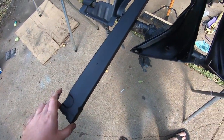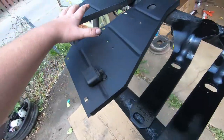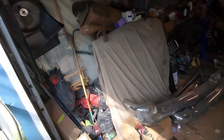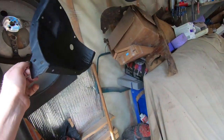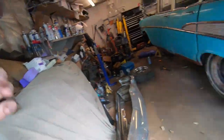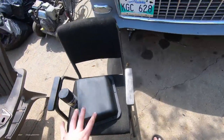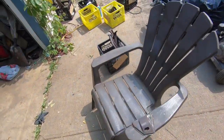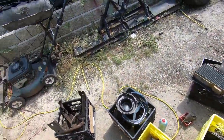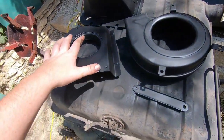So I've got some bumper brackets - this one looks like it's gonna join the fenders together, there's a hood latch, more bumper brackets, and these will go either side of the radiator on the core support. I've got these two little pieces painted up that look like they go behind the fender joining the inner fenders together. That one covers the heater core I believe. There are parts from two or three cars so there are extra parts. Over here I've got the blower motor - this kind of attaches to the fender.